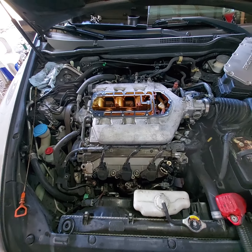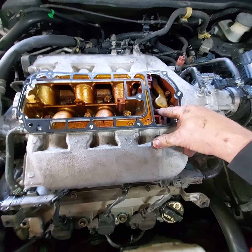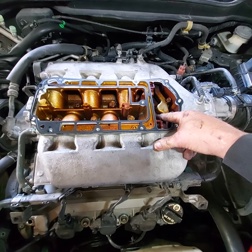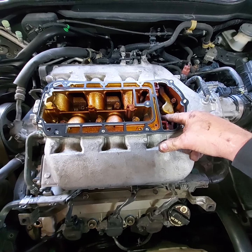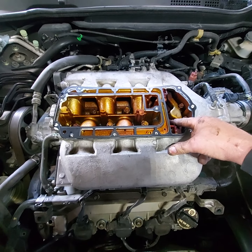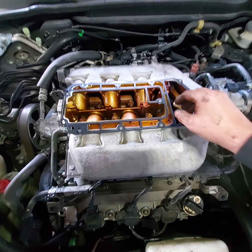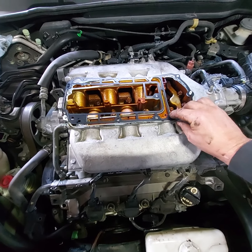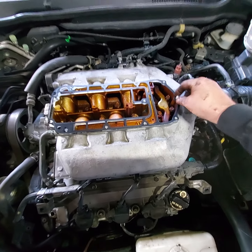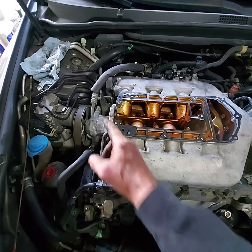Those bolts are all tight. Take the two nuts down to where they stop turning, then take them about a half to three-quarter of a turn additional. These are not head bolts, so don't get too carried away. Your top gasket or seal is also a metal seal, but it's just one layer and only goes on one way — if you turn it upside down, your holes won't line up. It goes with the rounded end on one end and the straight edge on the other.